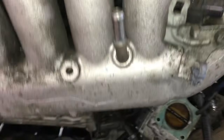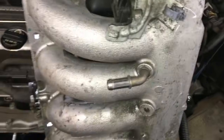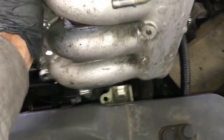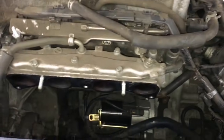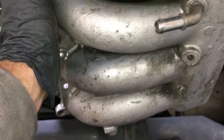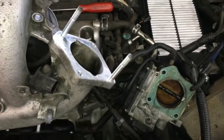But you're going to take your intake manifold like this and turn it on its end and get it to route through here. And then once you get it below everything that's here, you'll rotate it back clockwise and then put it back over the studs that are there. And that's also going to be towards the driver's side of the car. So you'll put it in, and then as you get it down below, you'll rotate it and then move it over and then put it on.